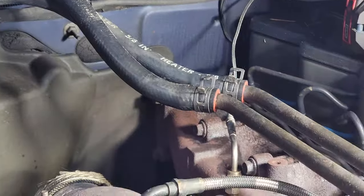I'm working on the wiring harnesses and need to cut some of them because they're a little long. When routing the fuel pump, you want to be no more than 10 feet away from where you're sucking the fuel, so I'm going to mount it in a convenient location on the frame, drill a hole, mount it, then cut the wiring harness short. Tomorrow I'll drop the fuel tank and run the fuel lines. Here's the fuel pump installed up on the frame — it's got a bolt through the frame. I ended up not shortening the wiring harness and just tucked up the extra wire underneath the crossmember, then it runs up into the engine bay.